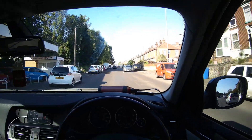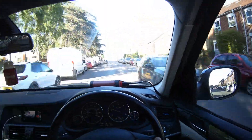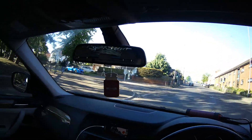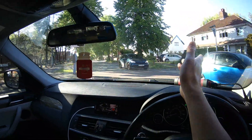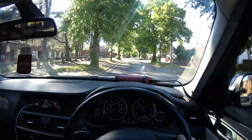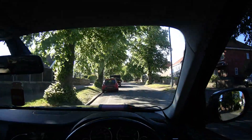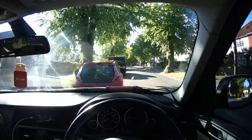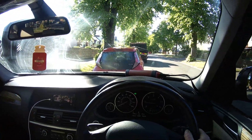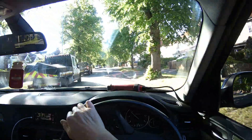Okay, so this is the standard test drive. If you're wondering how I'm recording, I'm not holding a camera — I'm wearing recording glasses. To activate the stop-start function you have to drive above about five miles an hour in first gear and press the brake at least once, or else it won't activate. So I'm going to pull up here and activate the start-stop briefly by lifting the foot off the clutch. As you can see the engine stops, then foot on the clutch and away it goes again. So the start-stop is currently activated and we're going to code it out in just a second.